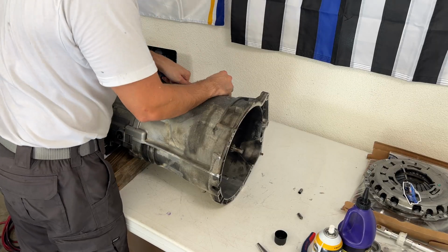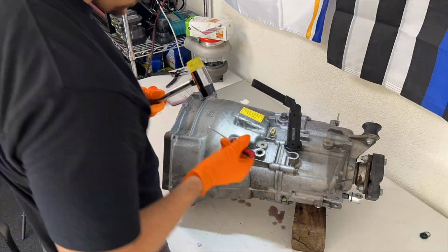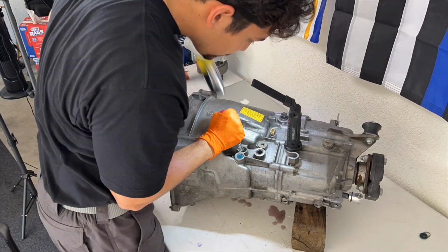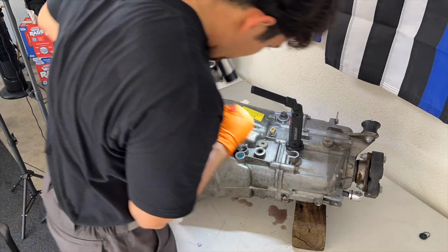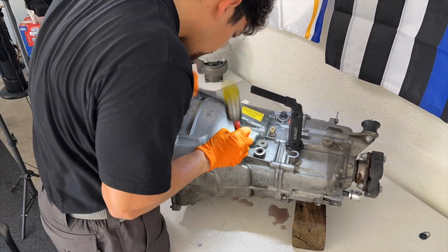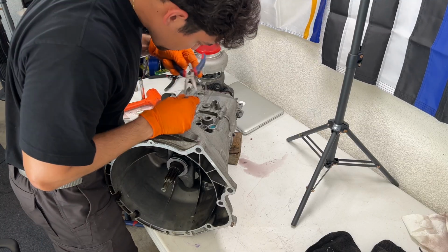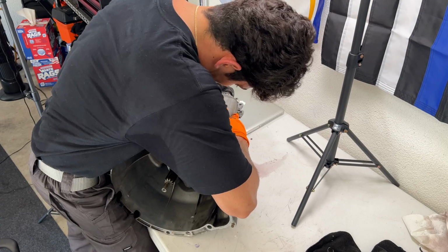If your flathead is too large, you won't have the fidelity you need and you'll just end up damaging the bore. Now you will mar the sides of the cylinder bore. There's just no way around it. But too large of a flathead and it could be really bad. Just be careful not to punch the sleeve into the transmission as you work it off the cylinder wall. With a ton of patience and perseverance, your sleeve should be bent and separated enough from the bore to fit some pliers inside to remove.